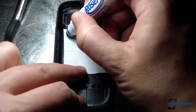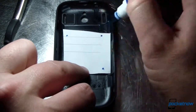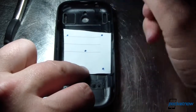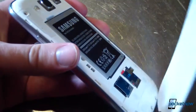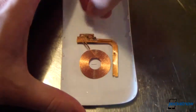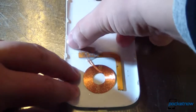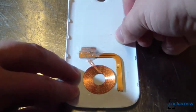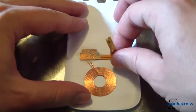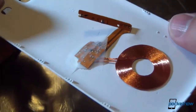You can do this more precisely with a drill and some shears if you prefer, but we want our wireless charging now, so we're already cutting corners — this probably won't come back to bite us in the butt, right? Next, we pull the battery cover off our Galaxy S3 and insert the Pixie's charging coil upside down in this orientation. We secure the circuit board to the battery cover with some tape — you can use hot glue or super glue later once you've decided on positioning. Then we fold the connector ribbon back on itself like so, so we have access to the contacts.